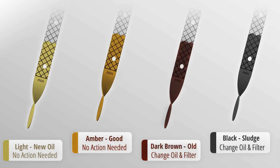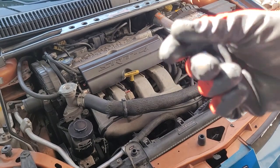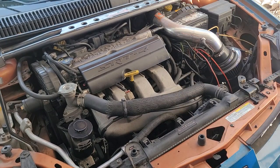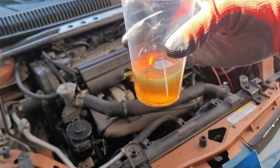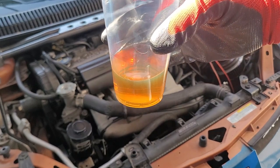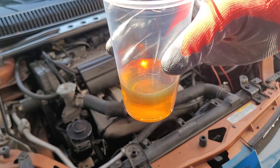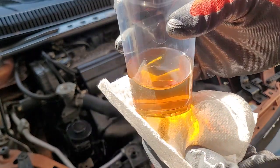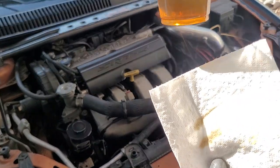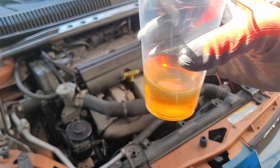Some oils have a little bit of difference in texture and color. What I'm going to show you now is what clean oil looks like — what was on my dipstick. This is clean oil, it's brand new. It's got a little bit of an orange tint to it. Some are more yellow than others, some are more orange, based on the additives in the oil — whether it's a high mileage oil or has anything added to it. This oil is consistent with what I'm seeing on my napkin. This is brand new clean oil — that's what it should look like.